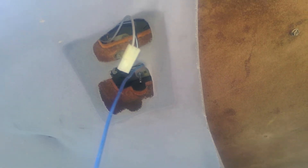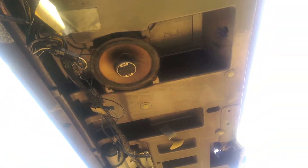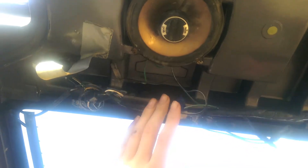This back light also has another input for the cargo door — when that opens it has a separate ground. That ground comes over here to this gray wire, through here, and plugs into the switch that sits over here. That gray wire runs through this spot and then runs all the way down your tailgate. To get the tailgate panel off there should be a bunch of clip panels, then you lift it forward and out. Once you get that panel off you're looking for this set of wires — your gray and your blue.